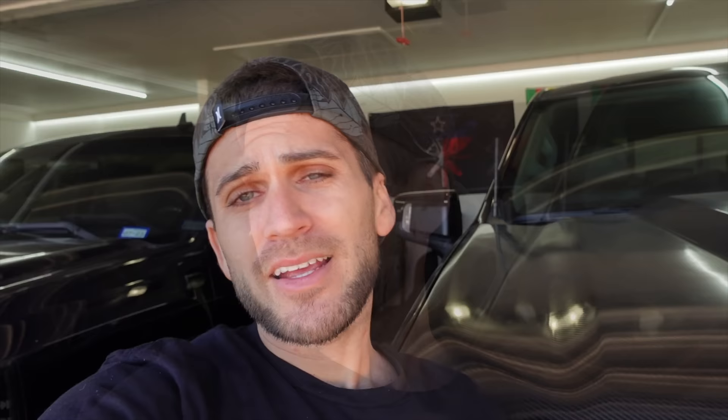The tool definitely did its job, but I'm blown away that another company hasn't come out with something better — this tool kind of feels somewhat prehistoric. My key feedback for the Quick Trick alignment tool: there's a lot of variability in the measurements. If you don't have the digital level perfectly butted up against the upright you can be off by over an entire degree, and the plastic it's made from isn't exactly straight — it has curves at the top and bottom so it's easy to get it wrong. It wouldn't be that difficult to engineer something that sits flush against an aluminum bracket that is perfectly 90 degrees. The turntable plates are nifty to have, especially with 33 to 37 inch tires. The other piece of feedback is price point — I still think it's priced too high for what it is, but it seems like the leading tool for a DIYer like myself.